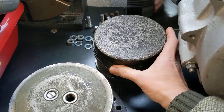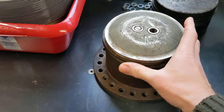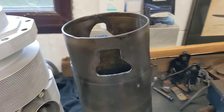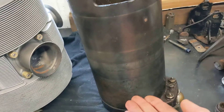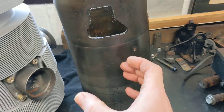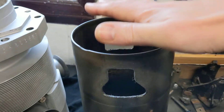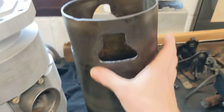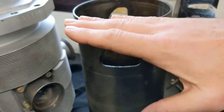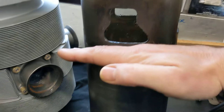The piston has got compression rings - they are compressed in normal operation and they spring outwards. The head's got compression rings too - they're compressed in normal operation and spring outwards. If you look at the sleeve you can see why: the piston is inside here moving up and down, so you want a really good gas-tight seal. The rings on the piston spring outwards against the inside of the sleeve giving you a nice gas-tight seal. The cylinder head rings descend past the holes or ports - which are the valves - and that gives you a really nice gas-tight seal between the rings of the piston and the rings of the head.